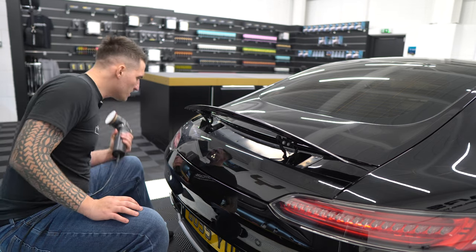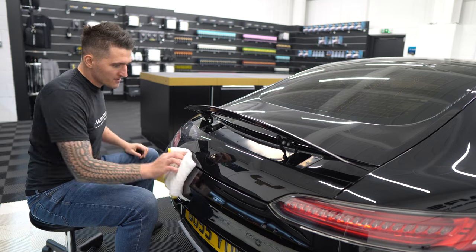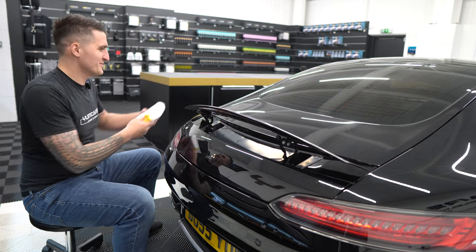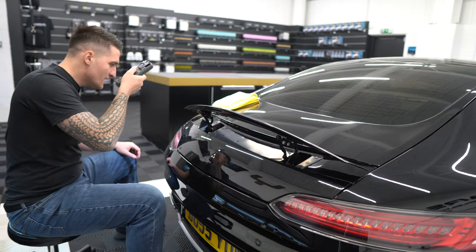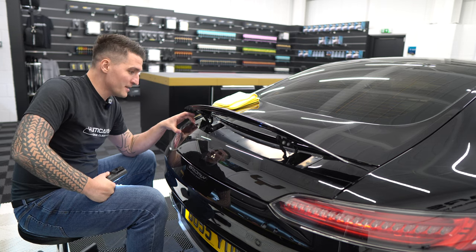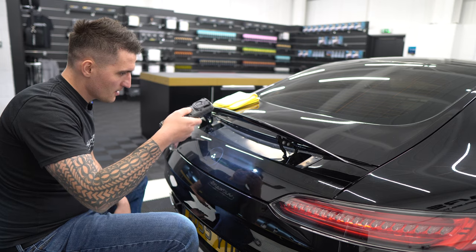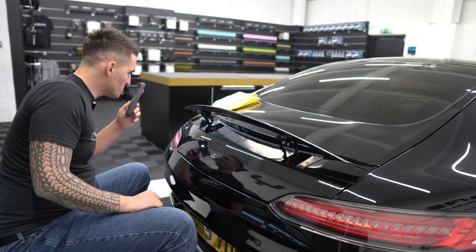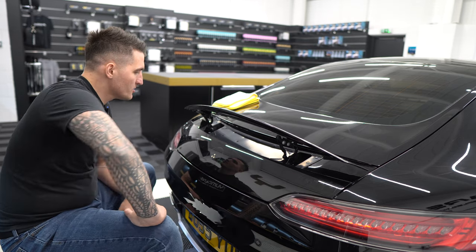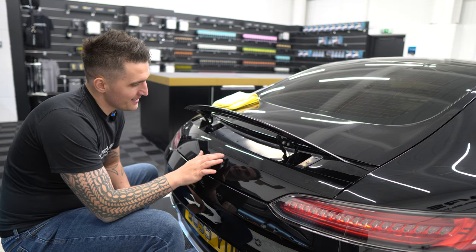Speed was set to one — that's why it was a bit slow. The good thing about this compound is that when you start working it in, it's very thin and you can actually see right through it. Just beautiful. Even though I haven't done a full 400 correction pass, this has cleared on this pass. I'm going to follow it up with a small pad to get it perfect, but it's managed to get everything out which is great. I'm going to quickly whiz over these two stars — you've seen me do this now — and then I'll show you a close-up of what naked paint without any sticker residue looks like.